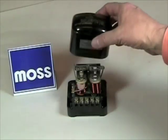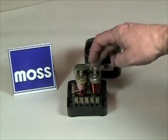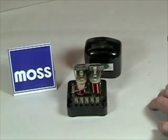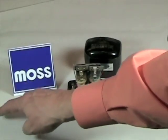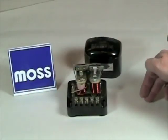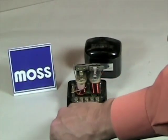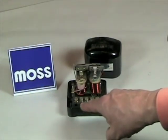The second function of your voltage regulator is controlled by this electromagnetic switch here. The purpose of this switch is to connect your generator to your battery. While you're driving down the road and the generator is working, we want the electricity from the generator to get to the battery so it'll charge it. To do that, the lead coming out of the generator enters the voltage regulator, and a lead coming from the battery also enters the voltage regulator near the point.